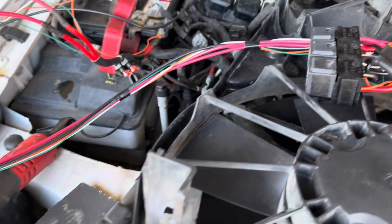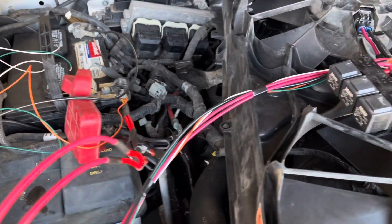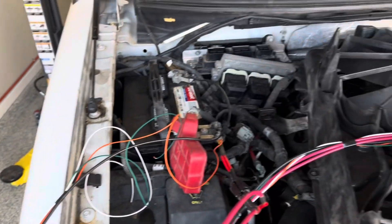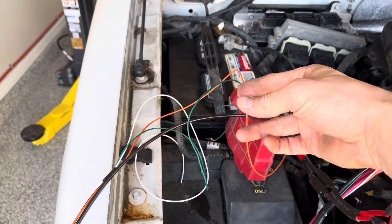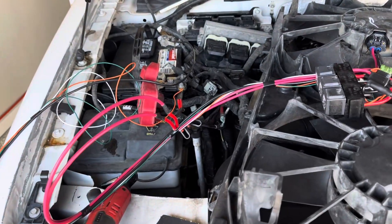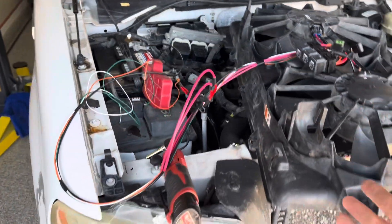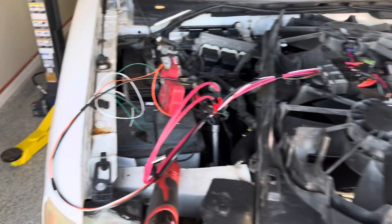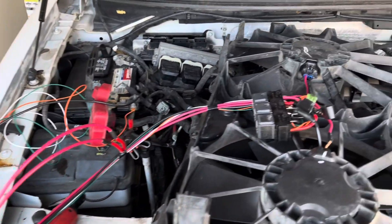This is a crude test setup, but all the theories check out. The actual product I'll sell for this swap will be much cleaner. I'm also going to sell it in two parts — the swap harness and this fan harness sold separately — with an inline connector connecting the two, providing the always-hot fused feed for the relays and the trigger wires controlled by the computer, all nicely loomed. The fan harness is also designed so someone who just wants to upgrade to electric fans without doing a coyote swap can get it and hook it up to the battery with their own trigger wires. The swap harness is done and next video I'll test it to make sure it actually runs a motor. Stick around, hit that thumbs up, and consider subscribing.